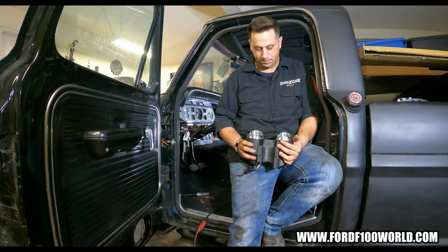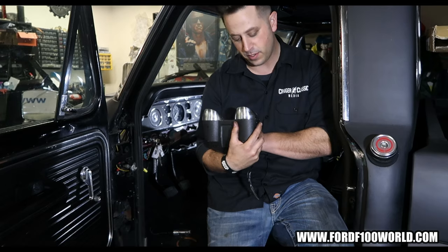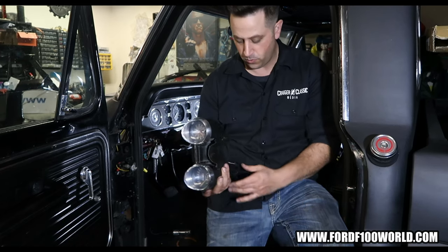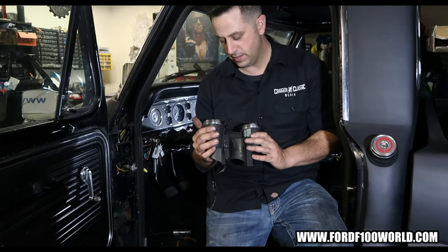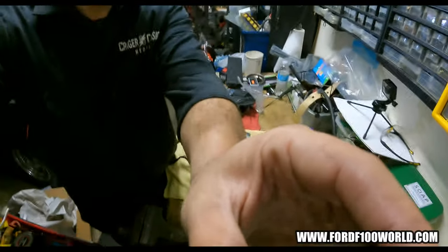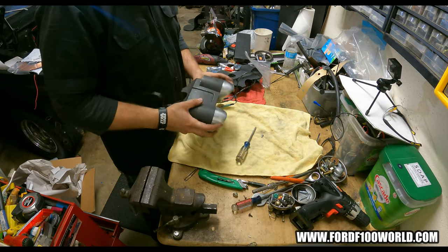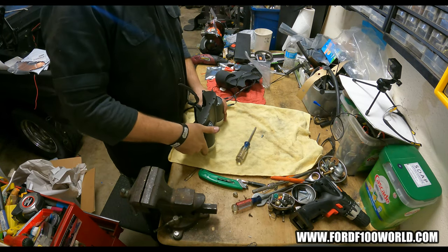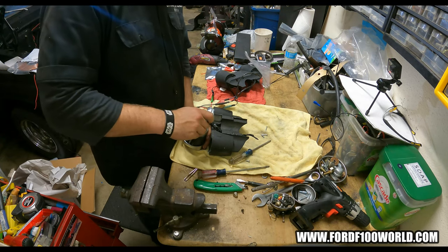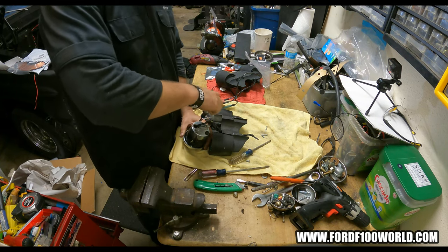That's why I waited and just sort of put this together. But it did pretty good — this tack, if it worked, was pretty close to the original one except this is 8,000 RPM. I might see if I can't fix this and get it going again. So to remove these, if you need to get to the lenses or want to take these off, there are two screws in the back. Once you've got the gauge out, there are three screws holding the bezel onto the gauge housing. On the new one, by first glance, everything is Phillips.